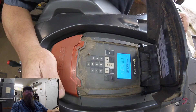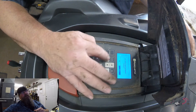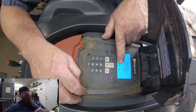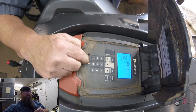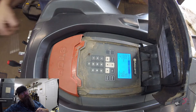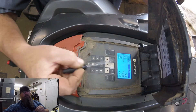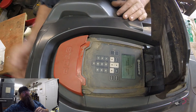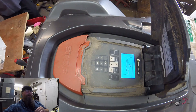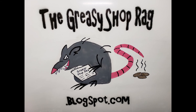My phone's giving me grief. We set the time and date, and you can see now I've got 50 percent battery — the other board wasn't recording the battery voltage at all. You can see on this screen that the capacity is 4,160 milliamp hours and the current capacity is 2,232 — the other battery is very similar. So they're half charged, but the thing was reporting zero. This is a screen you'll see if you put a brand new board in, and you can't go any further than this without hooking up to auto check 3. That's all I've got for you — Husqvarna 450 main board install. Thanks for watching.